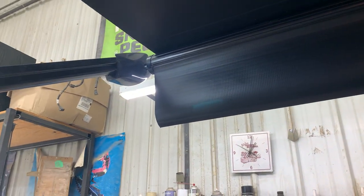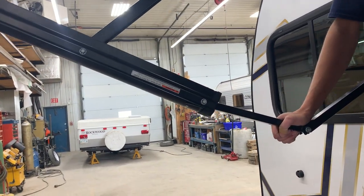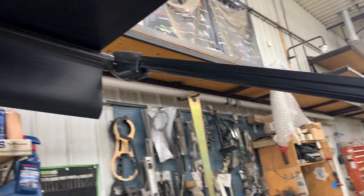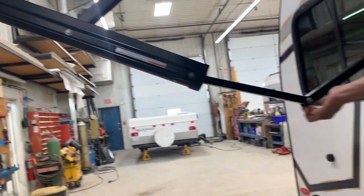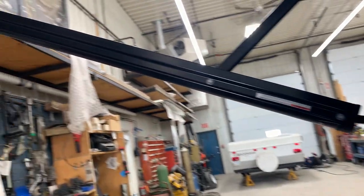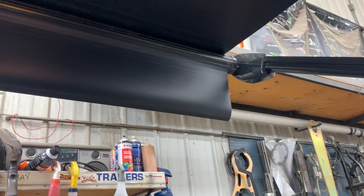Before you bring it in — if you take any arm, front or rear, and just push down on it, it's going to change the pitch of the awning, allowing water to run down off the top. If you like that angle better, you can do the same thing with the front arm and it will allow for more shade underneath. Just always make sure you push those arms back to straight before you bring them in, so you don't risk bending anything.